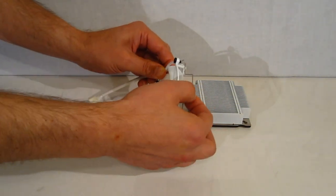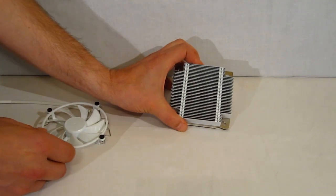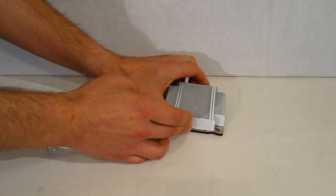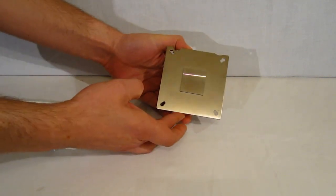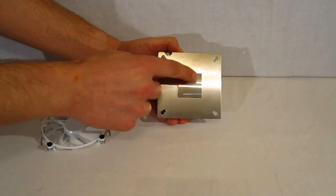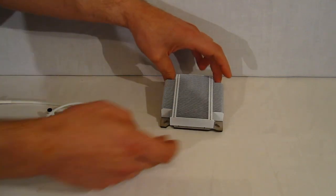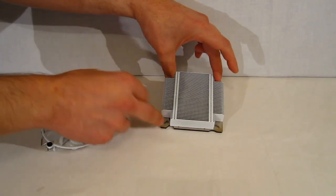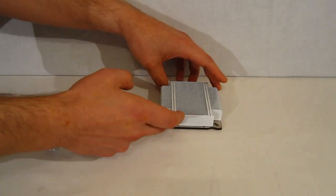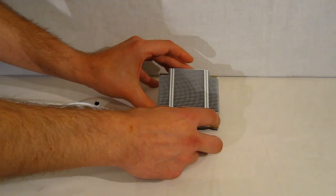Simple clips attach it onto the heat sink itself. Looking at the heat sink, we see it is finished in white, with aluminum fins on a nickel-plated copper base — very simple, with a milled finish and a protruding block for the contact plate. Really a very simple design, with four holes on the outer side to put the cooler in place. You can see with the white finish they do use the cold plasma spray and also the physical thermal antioxidant shield.